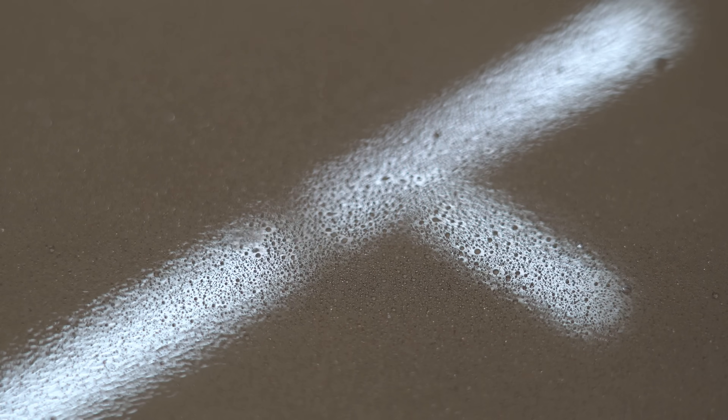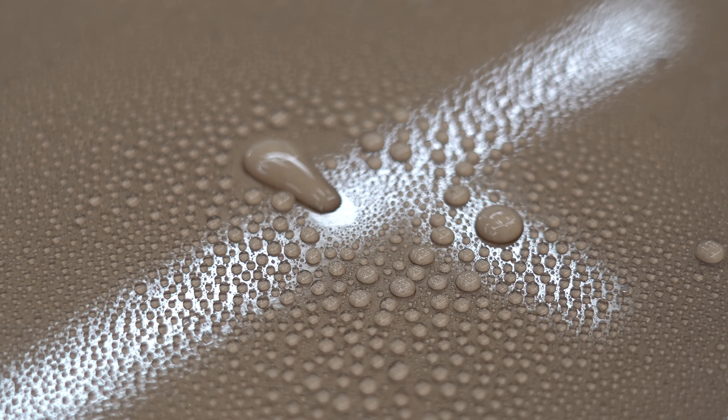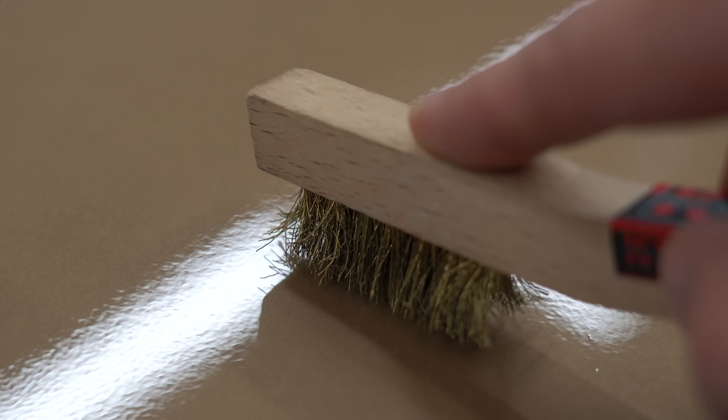Here's a quick little test to demonstrate this. We have a sheet of painted metal, covered in Expel Ultimate Plus paint protection film, and then covered in Fusion Plus ceramic coating. First, I'm spraying water on the surface to show the hydrophobic properties of the ceramic coating. Next, I take a brass brush and create surface scratches on the film and coating.